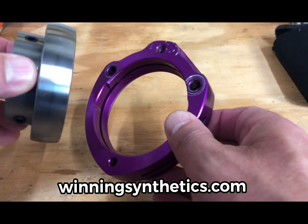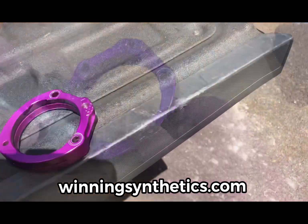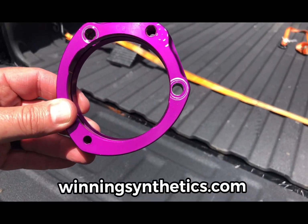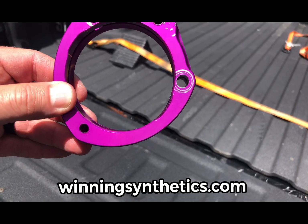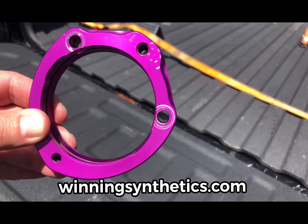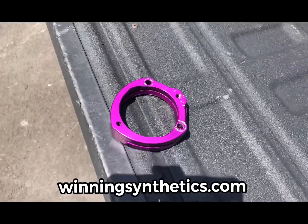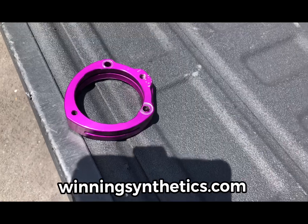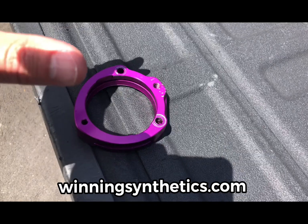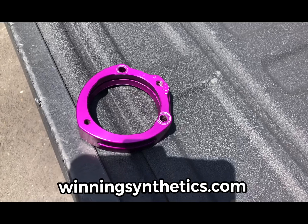So I'm going to show you an old tool and die maker's trick I learned back in that business a few years back. Check this out. All right, as you saw a second ago, this is a pretty tight fit. We're talking about a difference of only maybe 3 or 4 thousandths of an inch that this hole is bigger than the bearing I'm trying to put in it. So what I'm going to do, this is aluminum, and aluminum conducts heat very, very well. So I'm going to sit this out here in the sunshine and allow it to warm up. Now it's in the lower 80s today, so in direct sunshine, that should get up well over 90 degrees. My goal is just to allow that metal to expand a touch, just a couple thousandths of an inch, to make that bearing slide in a little easier. But that's not all.